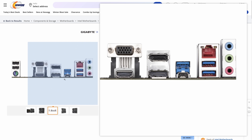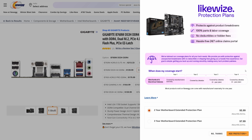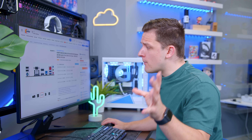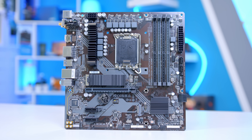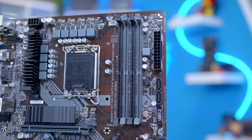You've got that USB-C connector, you've got Ethernet, and if you spend a bit more on the Wi-Fi board, which I'll link alongside everything in the description below, you haven't really got too many issues getting going. Crucially, for a budget build like this, this board is also DDR4. That's going to save us a lot of money on the memory. While I'd rather build a DDR5 system, there just isn't a great deal of performance upside for a super budget build.